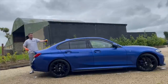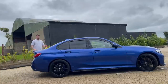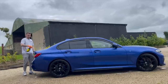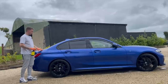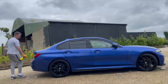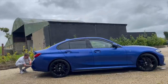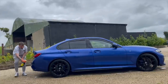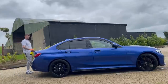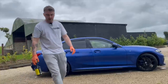Iron remover on the glass - glass is key as well. After this I need to get the tar remover out and go over both sides. The paint is feeling a bit smoother already. Why do you use iron remover? Basically there can be a layer of iron particles on top of your paint before you clay bar - especially if you live near a building site where there's a lot of metal cutting going on. You need to remove the iron from your paintwork before clay barring, same with tar.